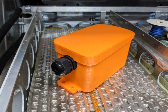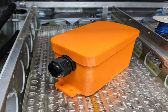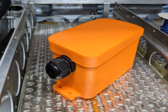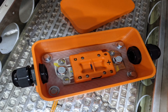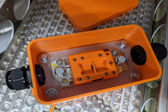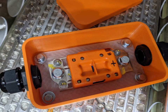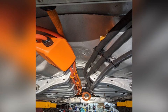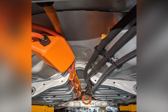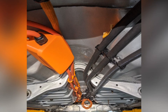Also on the way to the front, I needed a place for the fuse, so I'm using a Tesla Pyro fuse. I 3D printed this box out of ABS — it has holes printed into it for waterproof glands, and a printed lid that will be securely attached inside. There's another component that holds this fuse; it's about an inch and a half to two inches thick. I had to line it up so that when the wire comes in with the connector, everything is straight in. This is not only another disconnect point, but a handy place to make junctions. It's hard to have one wire run from the last module all the way to a module up front, so this makes a nice disconnect separating the battery packs if I need to remove or service them in the future.